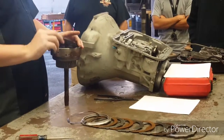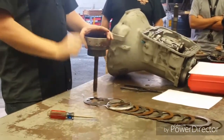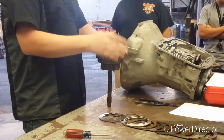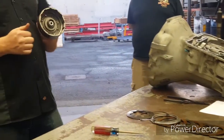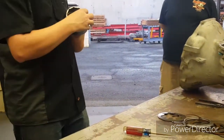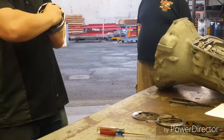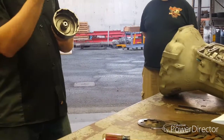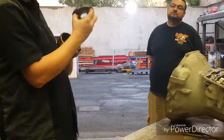We're pulling it down. Same thing — I'm going to take this out and put it back in correctly. You can install it upside down, but if you do that, I can promise you it's going to burn up your clutches. And the last piece down here is the piston. Take the piston — the best thing to do is you may be able to pull them straight out, but I typically go in there and start twisting as I pull them out. A lot of times that puts a little bit of dynamic motion on it and you're less likely to have it stick.